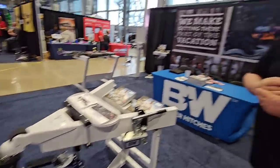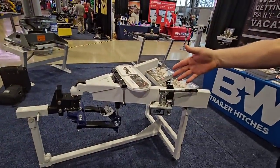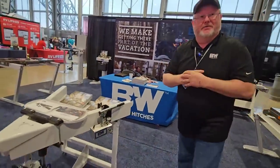What's the price point? It's $1,299. So that's right up there with most of your other premium weight distribution setups. And there are actually four part numbers because you have different shank sizes — two inch and two-and-a-half inch — and then a two inch and two-and-a-half with the underslung coupler. So different types of couplers give you the four part numbers.